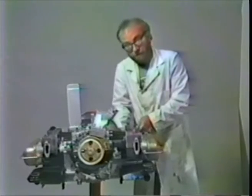That's good. Mark of excellence. Incidentally, 12 millimeter across the flat nuts are found on, as I said before, a lot of Japanese cars. So they're readily available now. They weren't for a long time, but they are now. It's the 14 millimeter across the flat nuts used for the case perimeter bolts that are extremely difficult to locate anywhere. And those are pretty much limited to getting them off old Porsche engines.